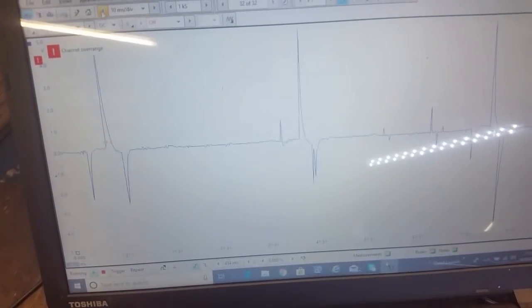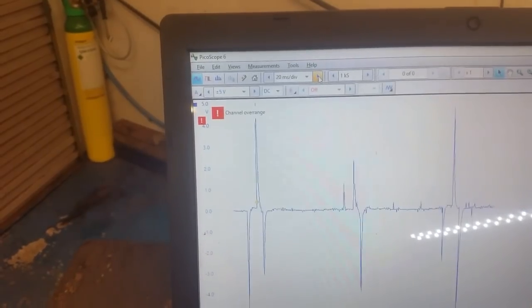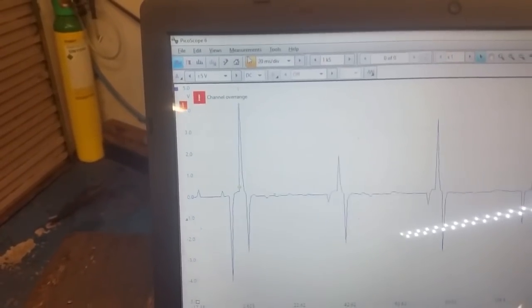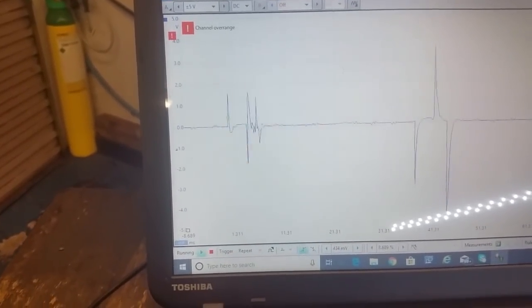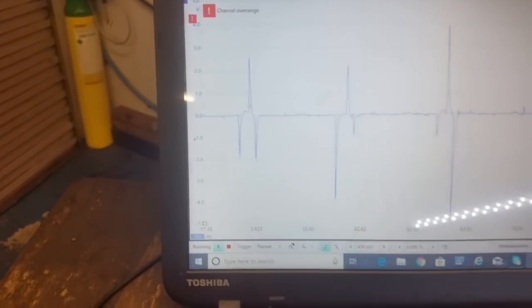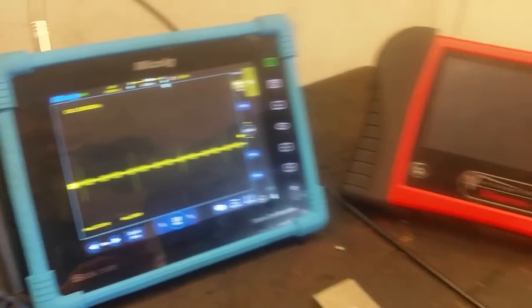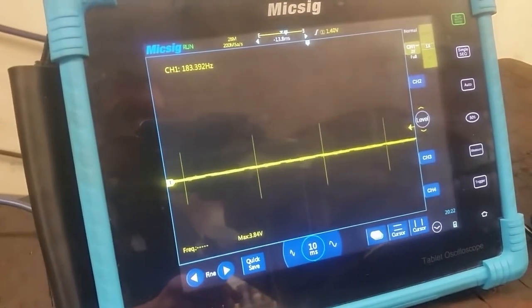As you can see, there's a vast difference in the size of the capture. We're going to bring that down a wee bit — 50 milliseconds — going the other way, 5 milliseconds per division, keeping it at 10, and it's on a repeat trigger with the trigger over to the left. I've just figured out what all this interference is — it's this light. If I turn this light off, this shows you how sensitive this is. That's the light off. Looking good. We'll swap the leads over and keep that light off.